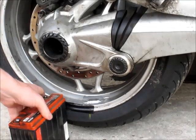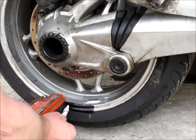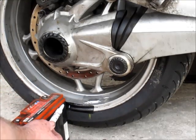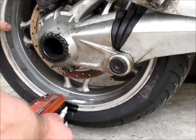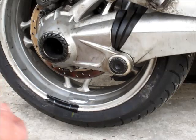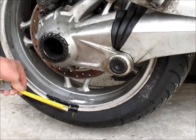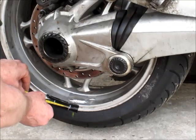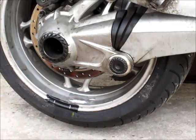Bike in first gear, solid item alongside the wheel, put a little mark in there. When the wheel is fully rotated one way, rotate the wheel fully the other way, put another mark, and measure the distance between those two marks. We're looking for 50mm. Anything 50mm or under is fine. If it fails that, it'll jump to 100mm almost immediately as the needles drop out of the universal joints.